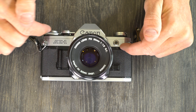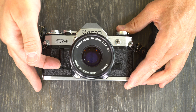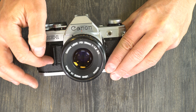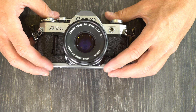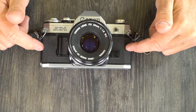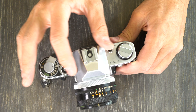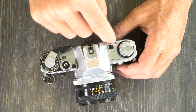This camera has two major weaknesses. The first is the battery chamber — these originally came with a hot shoe cover used as a key to open the battery chamber, but many have broken battery chambers and parts are getting harder to find, with no reliable 3D printed option yet. The second weakness is in the electronics — increasingly the flex, which is the electronic component that runs along the top over the prism and down, fails. Once the flex goes, the camera is essentially done — it becomes uneconomical to repair because you'd need a donor camera with a working flex.